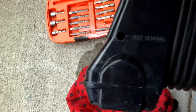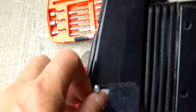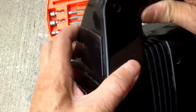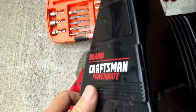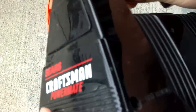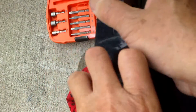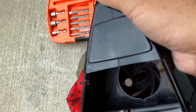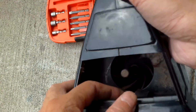There's a screw that you can unscrew. You don't really have to unscrew all the screws that are holding the vacuum cleaner together — just unscrew this one. And then there's a cover plate. I didn't bother looking up the manual. When you open it, you can access the belt.